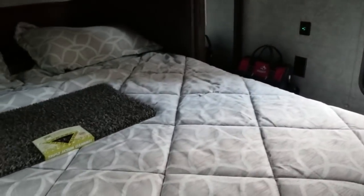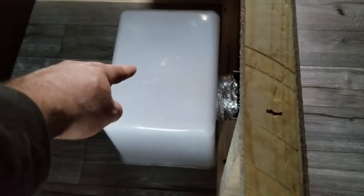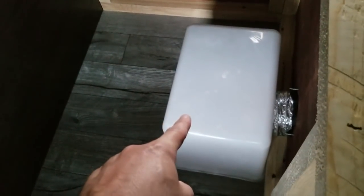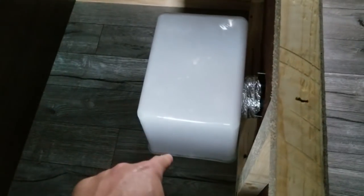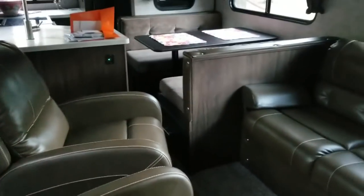In the bedroom, there's a black heater vent coming up through the floor right in the middle of the under-bed storage area — a really dumb place to put it. Anything stored in that bin could damage the corrugated aluminum duct. So I bought a cheap $1.99 garbage can from Walmart that fit the size, cut a notch around the vent with a utility knife, put one screw in each side and glued it down to the floor. Now it's a guard — anything we store in there won't damage that heater vent.